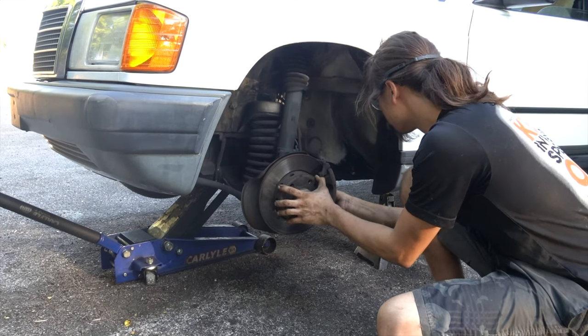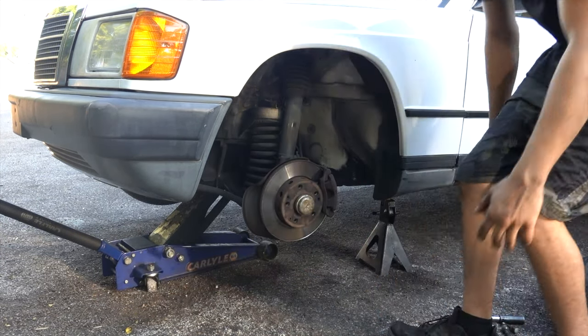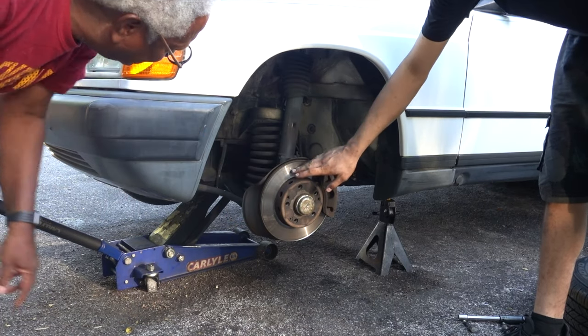One last thing: I don't like to buy any off-brand rotor — like a Duralast rotor from Advance Auto Parts, a Monroe rotor, or something from Just Brakes. When it comes to extremely cheap bottom-of-the-barrel rotors, you never know what you're going to get. Brake rotors don't just arrest brake vibrations — they have to stay together and not crack under high heat and hard braking conditions. If you have a Mercedes with a heavy front end, like a 300D Turbo or a 560SL, you can't cut corners here.